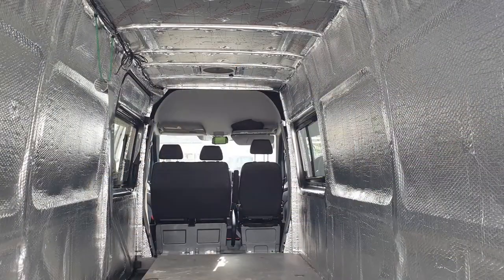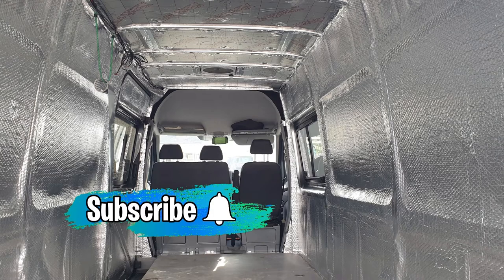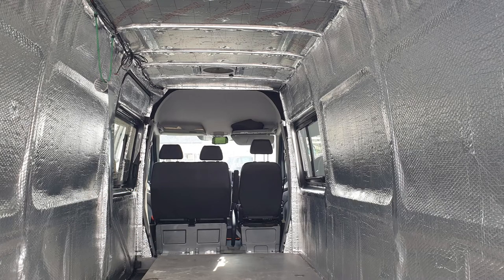When I got to this point in the van build, I still didn't know what electrical systems or equipment I wanted in my van, and I paid the price later because I had to make penetrations in the vapor barrier, seal them back up, run ducts through, and get cables to places that were pretty much inaccessible. I would suggest that if you know where your shower's going or where your galley or kitchen's going, install containment that will allow you to pull cables through if you need to, or if you change your mind later on - this will avoid the problems I had.